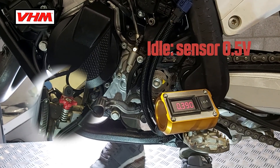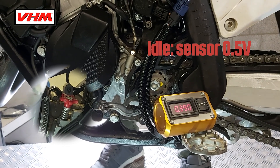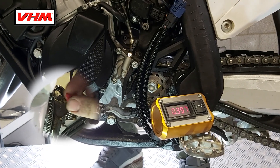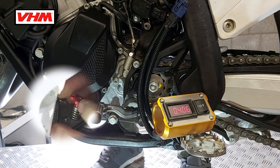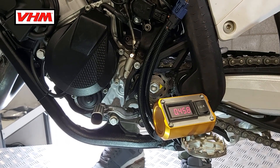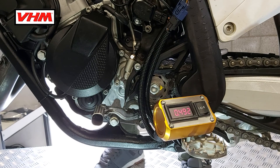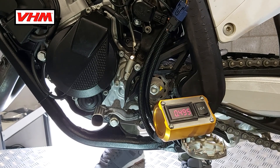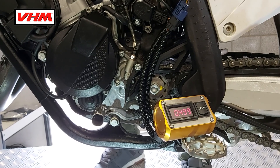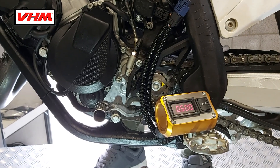The next step is to use the red knob and turn it back in until your voltage reads 0.5 volts. When you start turning, you will see the voltage change — this is the idle position. Normally when you put the dummy stick in, you should see 0.5 volts, which means your idle voltage is correctly adjusted. Target exactly 0.5 volts.